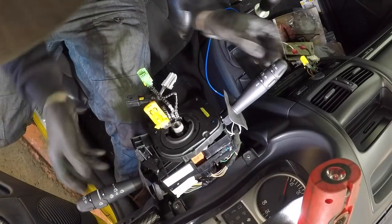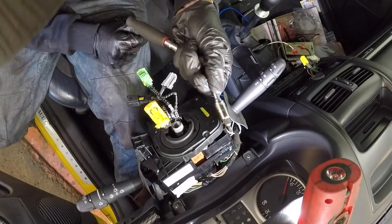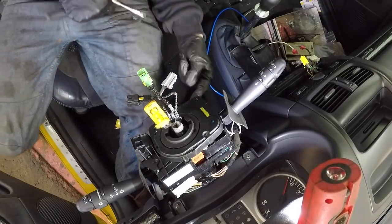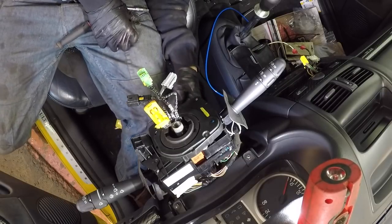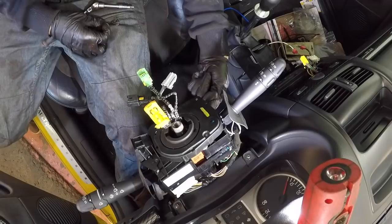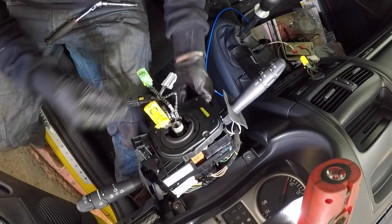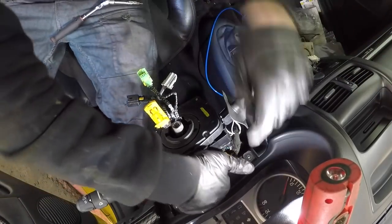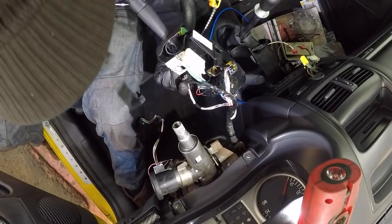Right, so now we're at the controls. There is a little, what are we on now? I think it's a T15 to be honest. Yeah, T15. And it is down here. I know I can't show you with the camera up there. It's at that angle, under there, little gold screw by the red wire. So we're slacking that off, and then down the back here, under this plug, if I remove this plug, simply pinch, there is a little lift up tab. You can feel it with your finger, give that a lift, and the whole thing slides off then.